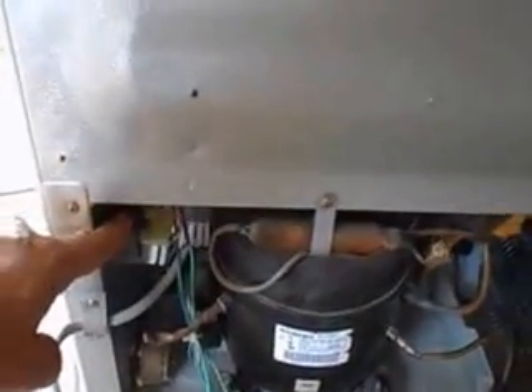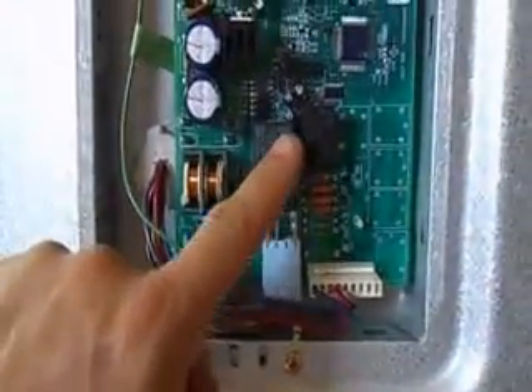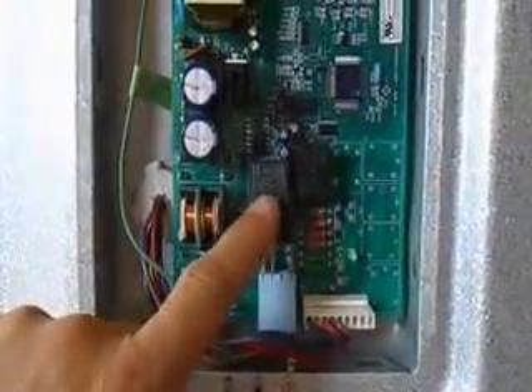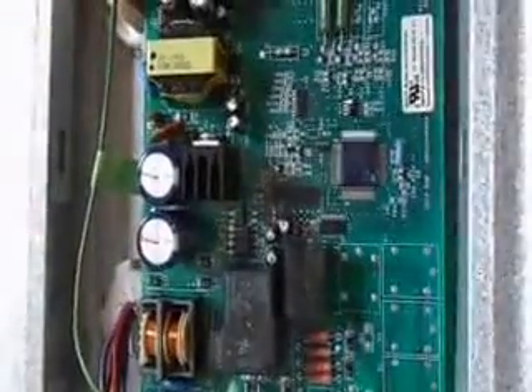What was happening was double clicking — click, click, click, click. The light was blinking on and off. And it wasn't the relay that starts the compressor, but it was this other little relay in here that wasn't actuating properly, because two of the capacitors on the motherboard were failing. When they start failing, the voltage isn't going properly and there were all kinds of problems.